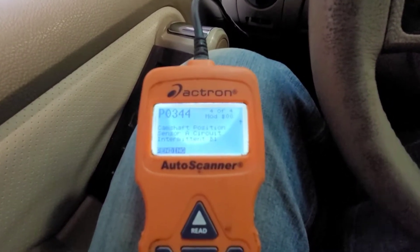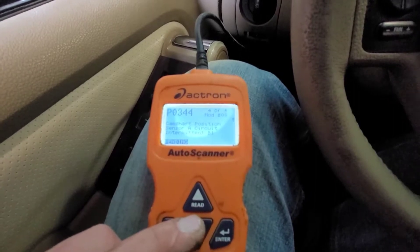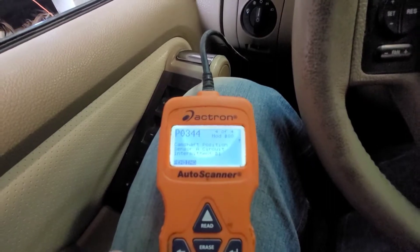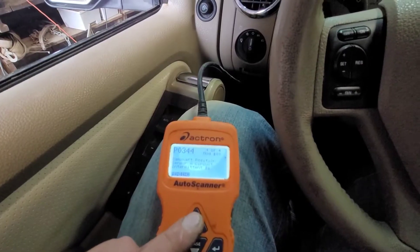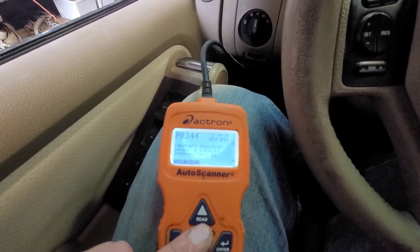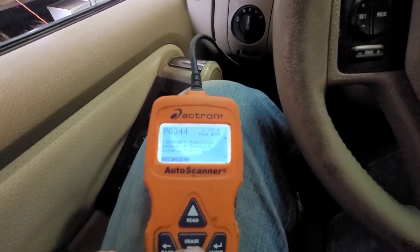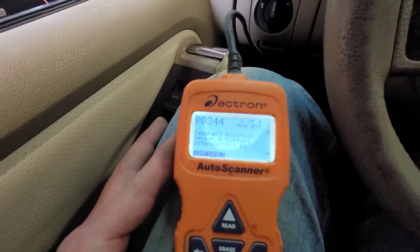If you're not familiar with OBD2 codes, a pending code means the check engine light has not been turned on, but the computer has detected something wonky in the circuitry and it's not meeting the specifications it's programmed for — either a sensor is out of range, something is broken, or something ain't right. A pending code will turn into a permanent code if it detects that issue for two or more drive cycles. Basically you start it up, drive it, it warms up, cools down, you shut it off, and you do that twice. That's what illuminates your check engine light.